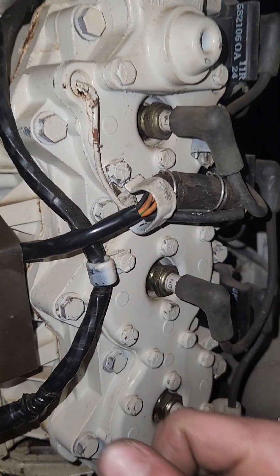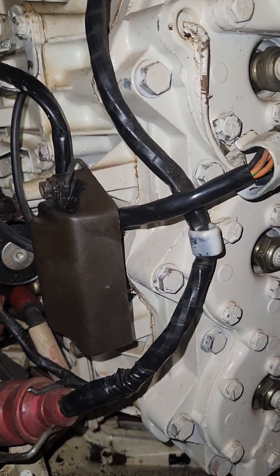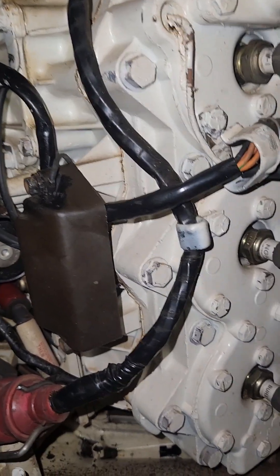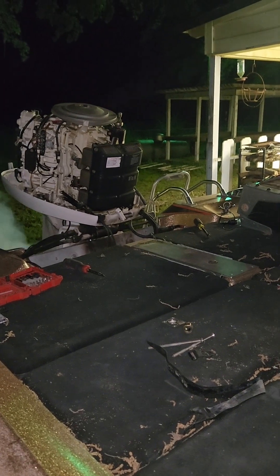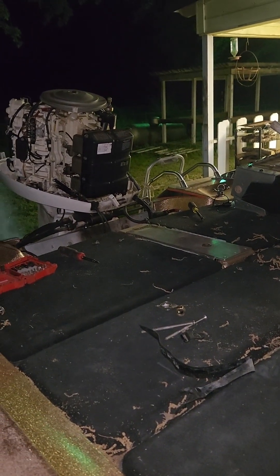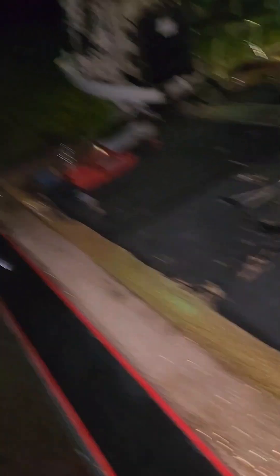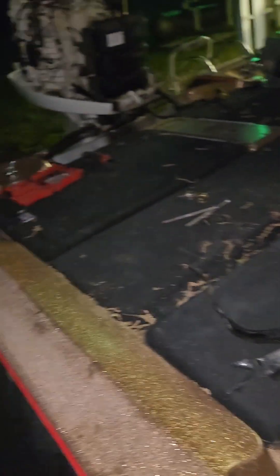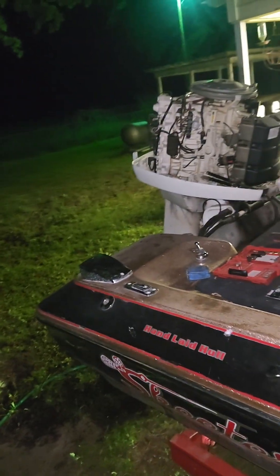The other way to verify this is what I did — I just swapped these two coil packs to see which one was bad. Ironically enough, I already have one ordered from Amazon; it was on sale for about $117 and I'm supposed to get it Monday. But ironically, since I swapped those coil packs over, the key works now. So I'm pretty much good to go — that's what was hanging me up: it wouldn't kill the motor when I turned the key off. Now I should have full safety.